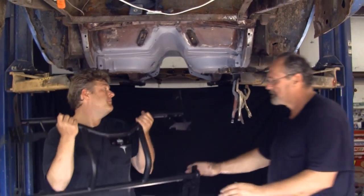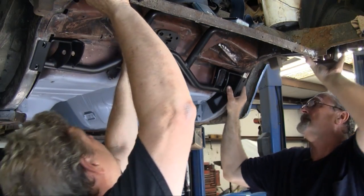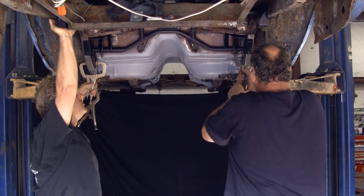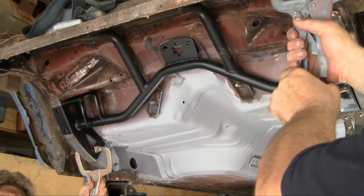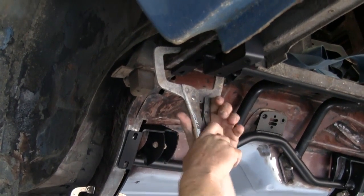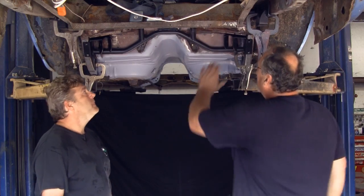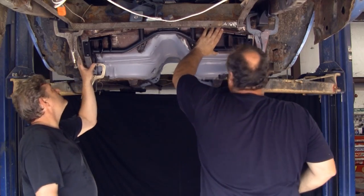This is a big old heavy piece — heavier the better, as far as I'm concerned. One of the things you're going to want to do is clamp this thing into position so you can get your measurements correct. One of the things you'll run into with these unibody chassis is none of these things are going to be perfectly straight and level, so you're going to end up probably having to muck around with this a good bit in order for it to stay tight and set up against the chassis. We're going to tap it around with a mallet so that everything is set as high as it can go. It might be best to do one side at a time so you're not fighting the other side.